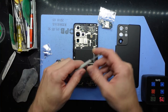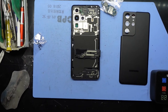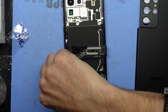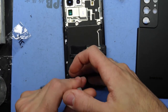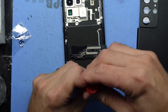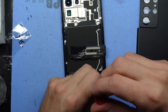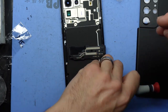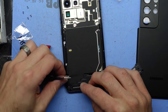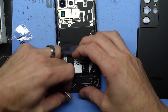I'm going to use a small Phillips head screwdriver to open it up. I'm covering the loudspeaker more so than the charger port in this video, as I believe I already have a charger port video out there. The main issue with this one is the loudspeaker not working and the microphone being a bit dim — the microphone is only working on loudspeaker, which is a separate microphone in this model. Getting to it is pretty straightforward. I'll use tweezers to lift that up, slide this way and lift.